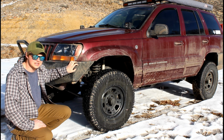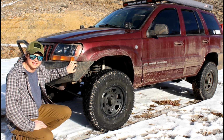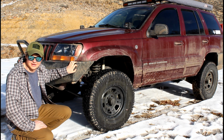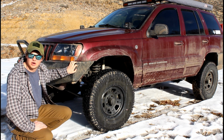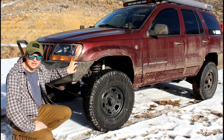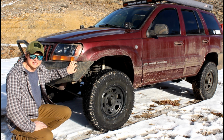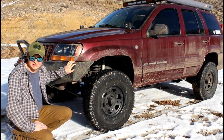And the front suspension is an Iron Rock Off-Road Critical Path long arm kit, which is a front 3-link style radius arm long arm kit. And I have only really stayed with the control arms from that. The coils, I never put the Iron Rock Off-Road coils on. I switched to a BDS coil, as it was a much stiffer spring and could hold the weight of the bumper and the winch without sagging.